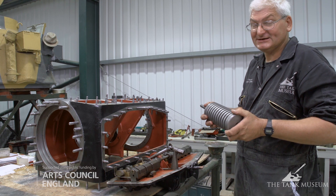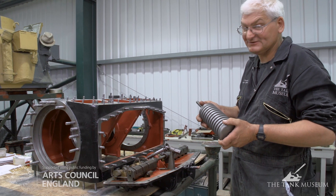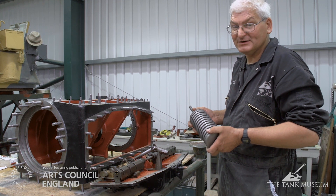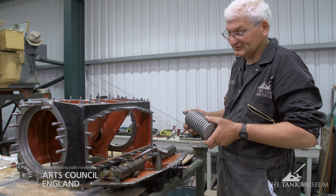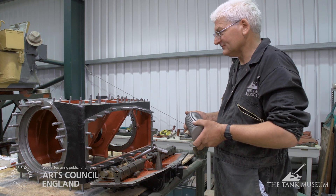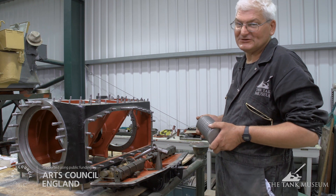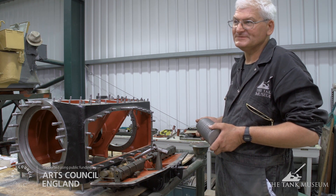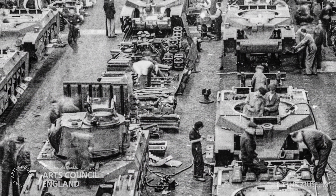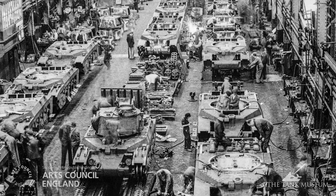The power of that spring necessitates a compressed air system in the vehicle to enable you to change gear — it's very difficult to do without the air; in fact you can't do it just using the change pedal. You're supposed to use a scaffold bar or pry bar to change it in an emergency to select one gear. Therefore the compressed air system and servos are very important. This adds to the complexity, but as mentioned earlier, the designers accepted the complexity to make the vehicle easier for the driver to handle. This is one of the things that makes the Matilda quite a high-tech vehicle for 1937–38, and we're relearning a lot of these processes as we go along.